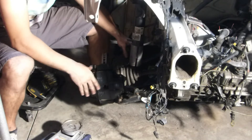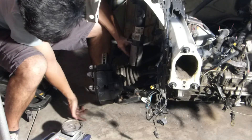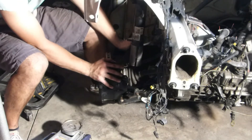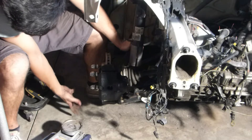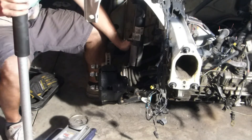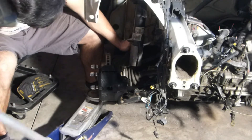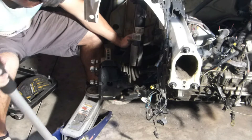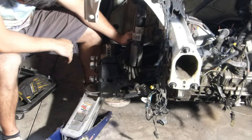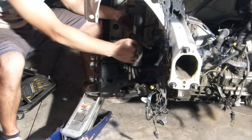I took out the old engine, and the jack stands are actually at the perfect height where the tire would just graze the ground going onto the hub. Right now, as you can see, we obviously can't fit a 16-inch wheel and tire setup on here, so that's going to change. We did lower the lower arm two inches, so that's about how extra low it is. I'm literally doing the opposite of lowering my car. Going up, I do have quite a bit of suspension travel upward and I can adjust and create more travel if needed, but I look like I should be okay.